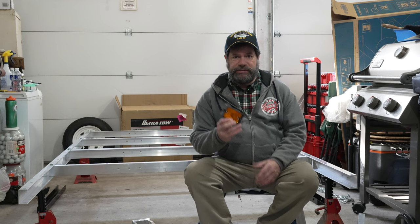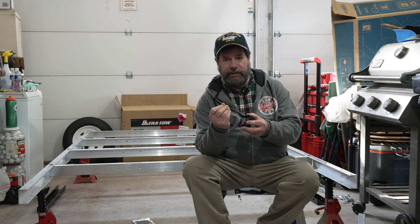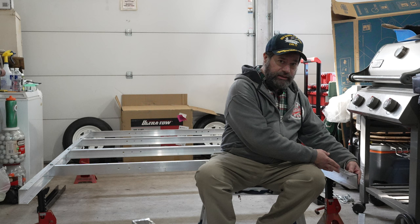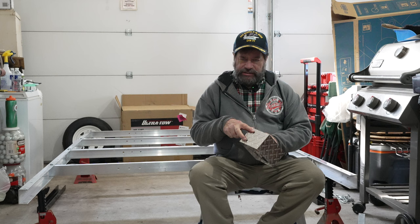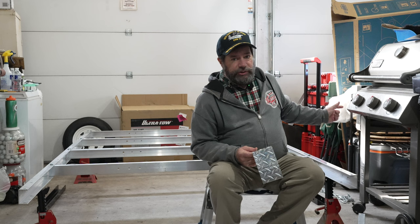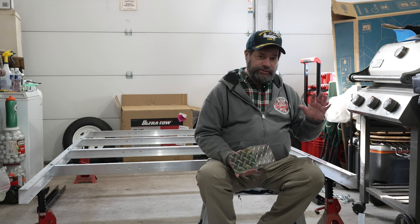This is the marker light for the front of the trailer. It has two little screw holes on it, and there is a place in the side rails for the wires to go through — that's a large hole. You'll see that there are two holes on the side that line up with this. That is going to be the front of your side rails. Now, in the back of the trailer, you have your lights. They would go into this box, and the box has two large holes that you will use to bolt this to the outside rail. When you look at the back of the trailer, there are no two small holes — there is no small holes, just two large holes. Remember that when you're lining up your rails so that you get everything straight.